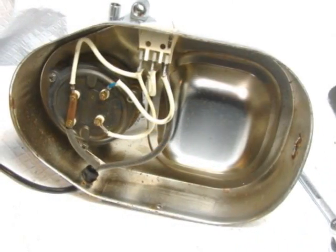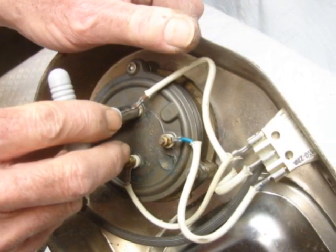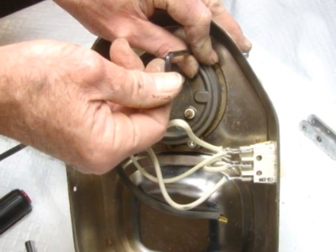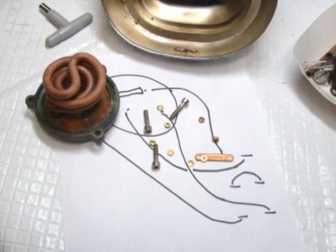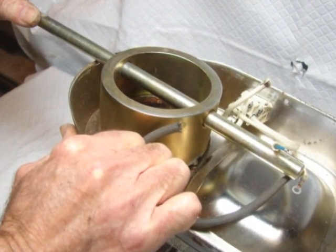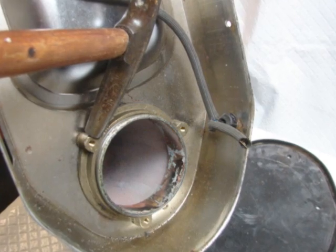What's under the hood now — the wiring diagram is going to help. Remove the small bolts and nuts, set them aside. Bolts out, heating element out. Now, to get that flange nut off — big problem. The official Pavoni factory tool isn't enough to do it. Penetrating oil, let it sit overnight — that's best. A sharp tap with a small hammer breaks it free and spins it off.